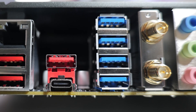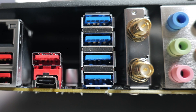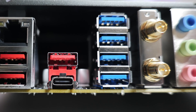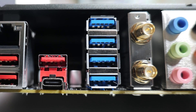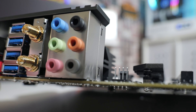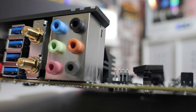It's actually quite unusual to see a fast port like that on a slightly more budget-oriented motherboard. Next up we've got a block of four USB 3.0 ports — that's USB 3.2 Gen 1 at 5 gigabits per second. Then we've got the SMA output connectors for your antennas for the built-in Wi-Fi 6E and Bluetooth 5.3. Finally on the end you've got the six analog outputs for your audio, which will support up to 7.1 surround sound if needed.